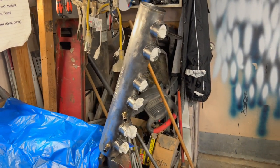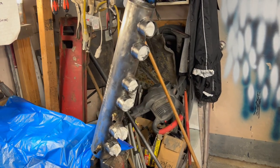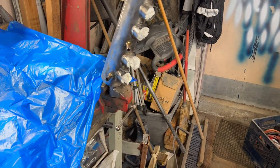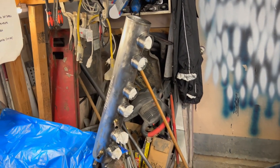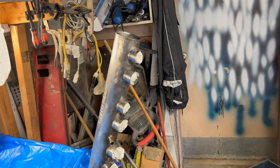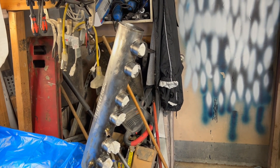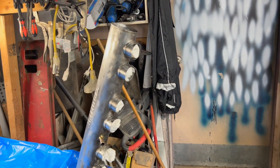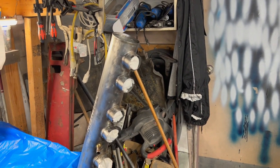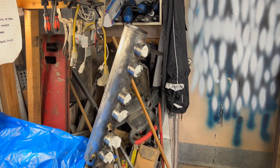We've got it all completely cleaned and scrubbed down now, ready for its coat of paint. We did put it through a dry cycle in the oven so there's no moisture left on the inside or in any of the nooks and crannies. Using this VHT wrinkle paint, apparently it's three coats — very heavy coats — going in alternating directions: horizontal, vertical, and then across. Apparently it wrinkles over a period of time; you can flash it in the oven, but that makes the wrinkling smaller. If this doesn't work out, we'll go back to the original plan of semi-gloss black, but let's give the wrinkle paint a try.